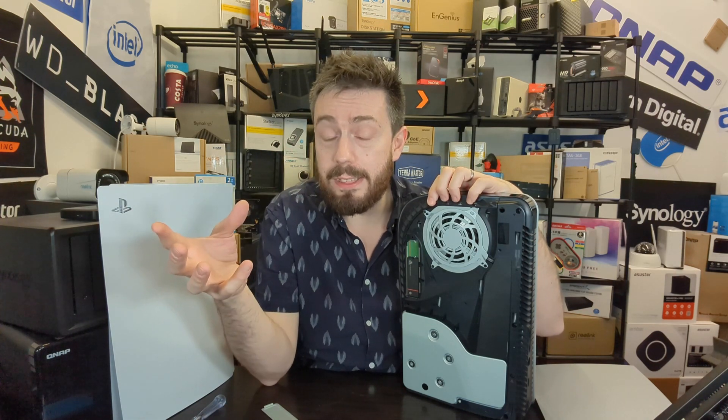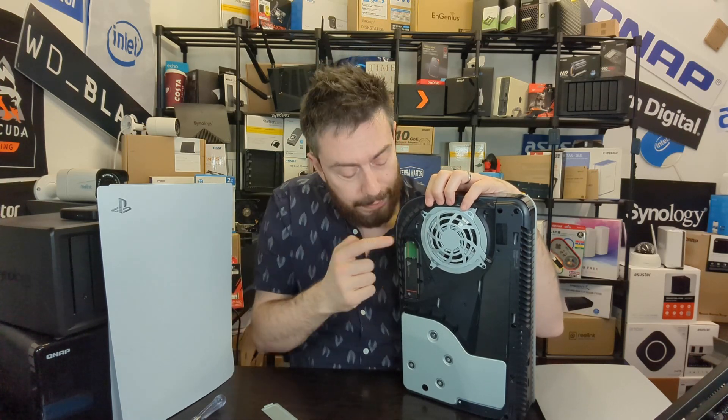The controller — the brain of the thing — needs to remain as cool as possible. If it gets too hot it can degrade and ultimately throttle once it surpasses 70°C. But even if it doesn't surpass 70°C, you don't want an SSD living in the 50s, 60s, or close to 70s all the time, because that SSD will ultimately degrade more over the length of its life.